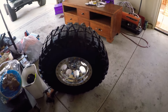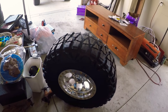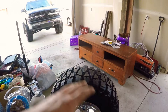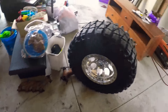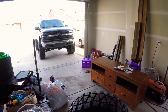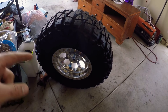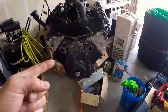So that's a quick video on ceramic balancing beads. Do a quick Google search or check eBay like I did — they usually have a chart with all the tire sizes telling you how much you need. I believe you do not want to run them in small car tires; I've heard that, so do your own research. But for big tires, it's the way to go.